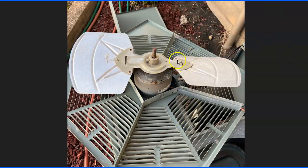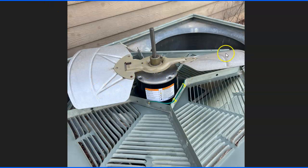So if you notice this fan, this is the old engine or the old motor. The shaft is only out about halfway, and there's still some room at the bottom. I didn't check the depth of this before I took it out. However, when I looked at this fan — this is the shroud on the air conditioner — a couple guys said you have to make sure to get it the right length. From what I found, the middle of this fan should be where this edge is. The grate fits on top up here, and you should have half of the fan above this shroud. Because if your fan is too low, it sucks air back into the shroud and rolls it back around, so it will not be as efficient in cooling.